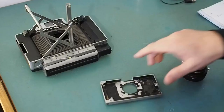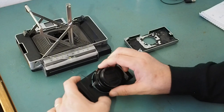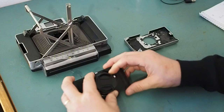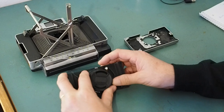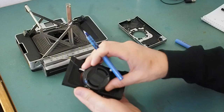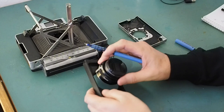I've now printed my first replacement attempt. I've got two cutouts in here to allow the lens shutter release mechanism to move and also the shutter cocking mechanism to move. This looks like it's a good fit, and the shutter cocking mechanism slot looks like it'll fit nicely. The problem on this first attempt is that we don't have enough space at the top for the flash X-M sync switch, and we also don't have enough space at the bottom for the aperture drive lever.